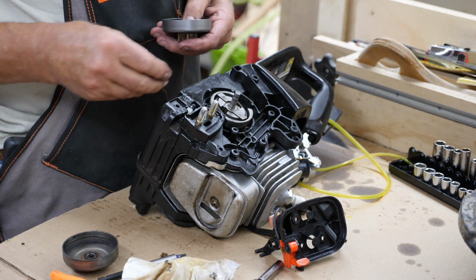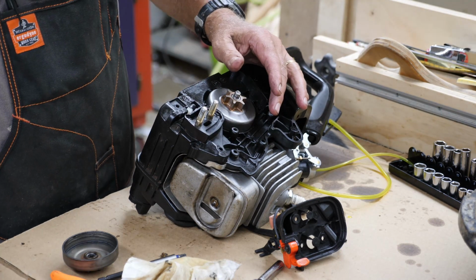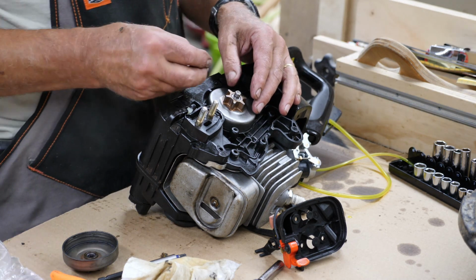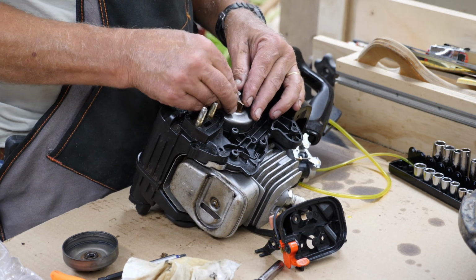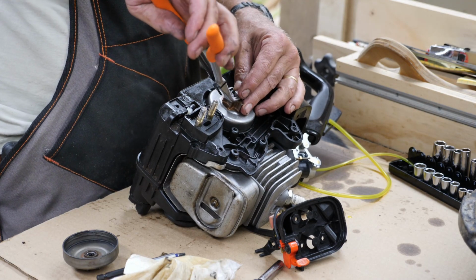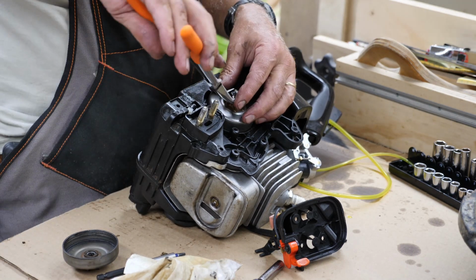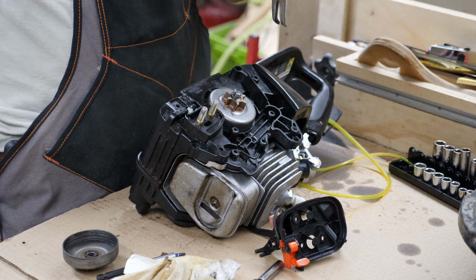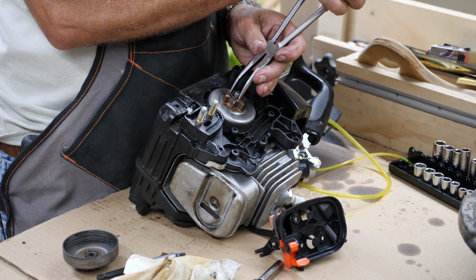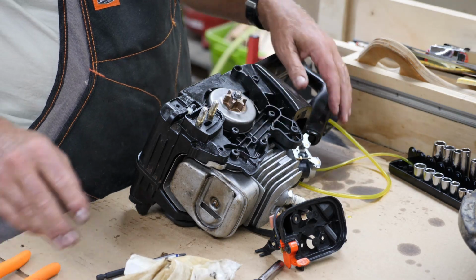And then I notice another little washer. There it is. That goes on the clutch. And the new sprocket over the top of that. And then there's an E-ring, which I'm hoping I won't send flying across the room here. This fits into a little slot. Not the right tool for it, but we're going to try it. Almost. Well, come on. There we go. So that's that.